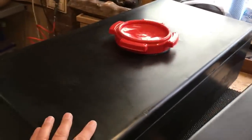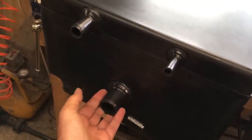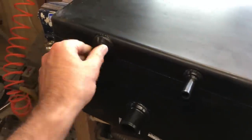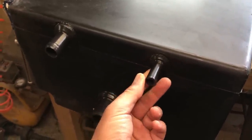It's a really hot day today, about 31 degrees, so it's going to be a bit warm underneath the van, but let's get stuck into it. This large tank is the fresh water tank and this smaller tank is the waste water. The connections: this is upside down at the moment - it's going to be fitted with the manhole at the bottom. This is the water inlet, so the large flexible hose on the side of the van will connect onto here. This is a drain outlet which will just be run to the skirt of the van with a little valve, and this is the 15mm supply pipe which will go to the water pump.